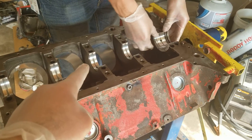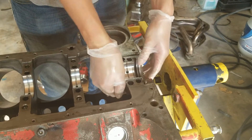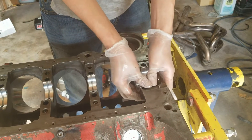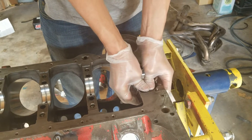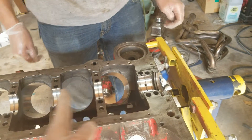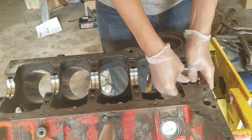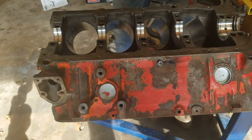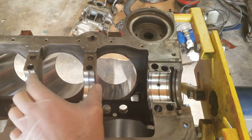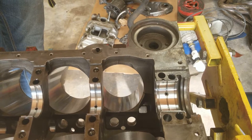After you get all the rest in, the very back one is your thrust bearing — that's the big one. It doesn't like to go in very nicely. This bearing is what locates the crankshaft axially in the engine. Checking thrust is another thing you should do when you're installing a crankshaft, and we'll show you how to do that later. Thrust is how much the crankshaft can wiggle in the engine end-to-end — it's supposed to be a little bit, but not much.